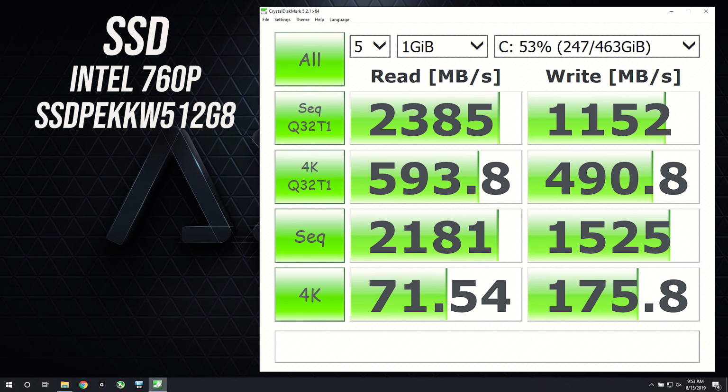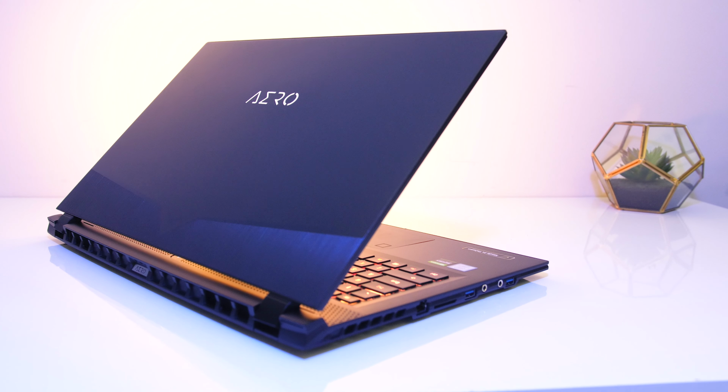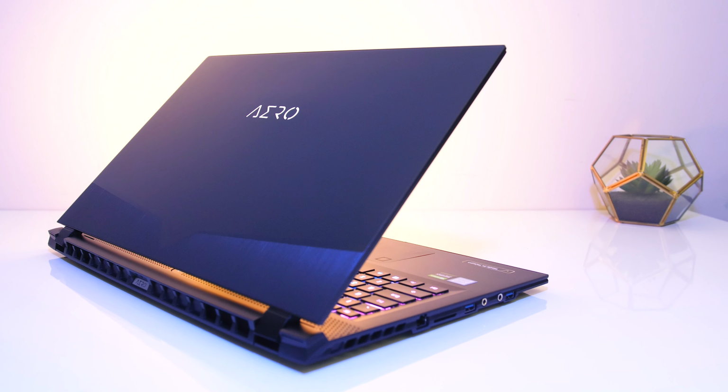I've used Crystal DiskMark to test the storage, and the 512GB NVMe M.2 SSD was performing well enough, though a fair bit lower on the writes compared to the reads, while the UHS-2 SD card slot was performing very well with my V90 card for the reads, but again much lower for the writes. For updated pricing, check the links in the description, as prices will change over time.